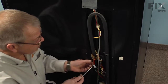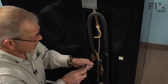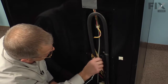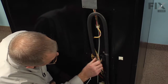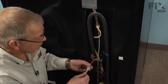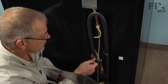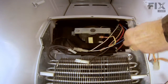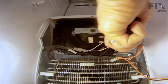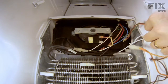You can remove this little end cap — just one less thing to have to drag through that opening. Take a length of heavy cord or wire, slip it in between the brown and the orange wire, make a loop around it and twist that together to hold it in. Now we can open up this putty to expose the opening to that hole. With somebody from the front pulling on it and somebody back here guiding it into place, we can pull that right through. Now we can remove the old harness.